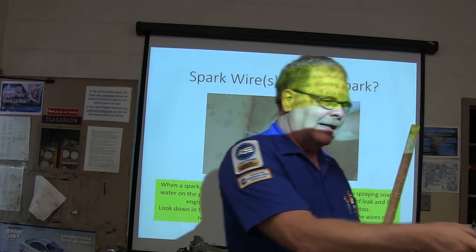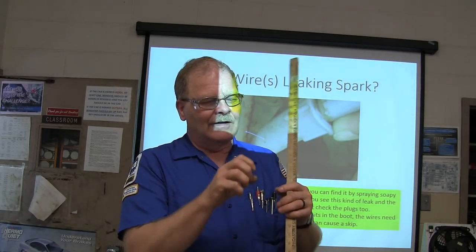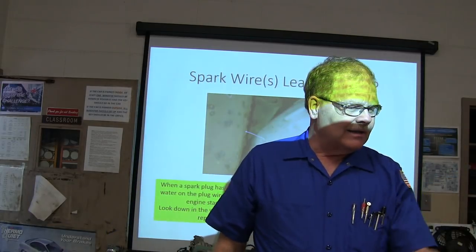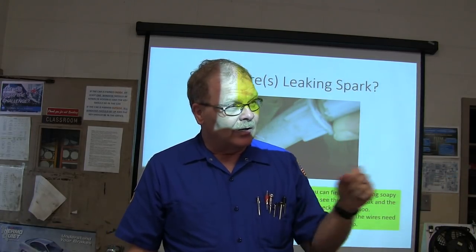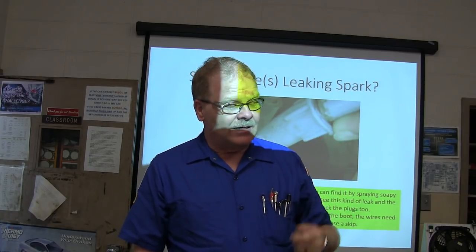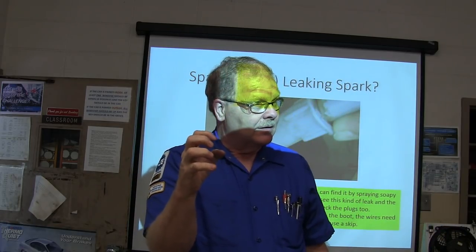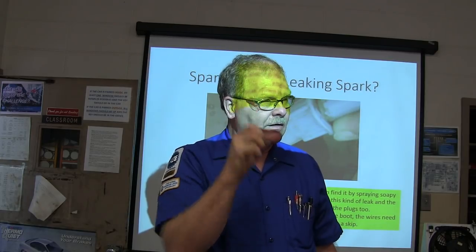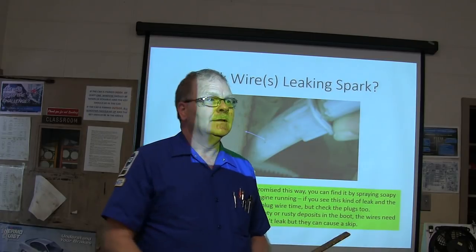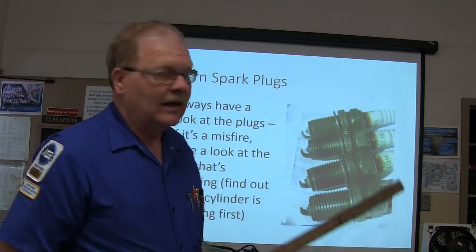You can also take a test light, hook it to ground, put it on the negative side of the coil. If it's making a bright pulsing, you can illustrate it on yours by hooking a test light and letting it flicker on the tach side. When you pull a plug wire off, you'll see a big bright strange pulse. If I did that and I didn't see a pulse — just a flicker, not a poof poof poof — I'd snap the throttle, and if it stumbled, I knew it needed a spark plug.